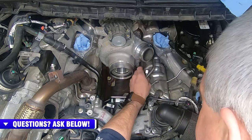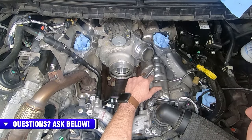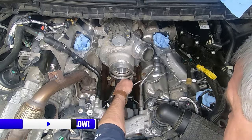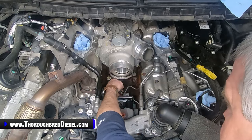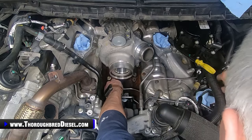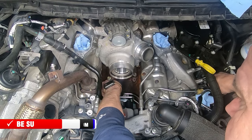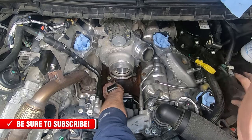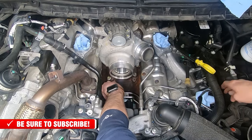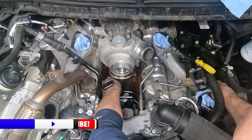When I do that, I will go ahead and push the fuel line nut end of it underneath of this high transition at the coolant line back here, just like that. And then I push it on through just a little bit. And then when it turns that last time, you'll see it meets up just about exactly where it goes on the DCR pump. So all of that looks good. And then that takes me just about over exactly where I'm supposed to be on the middle orifice of the rail here.